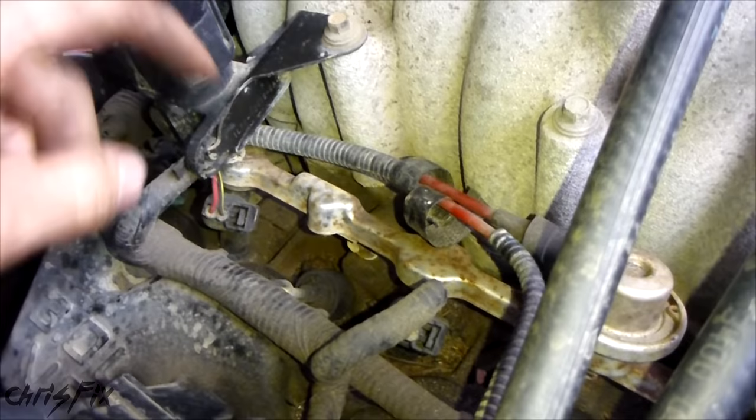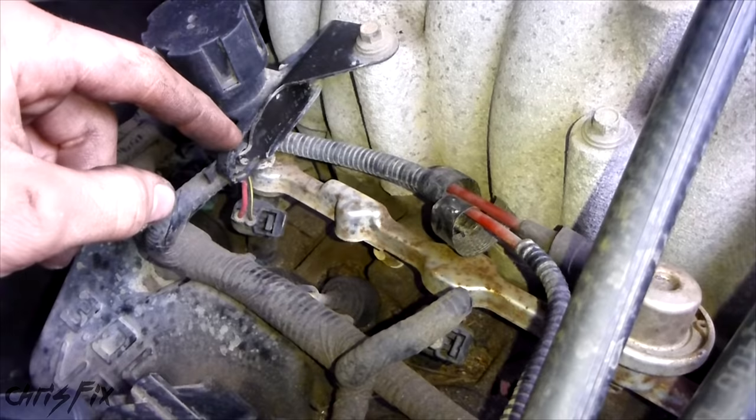This test will tell you which injector might not be firing or might be firing inconsistently, but that's all it's going to tell you. It won't let you know if there's a bad spray pattern because the injector is clogged, or if the pin isn't going all the way down because the spring is worn out, or if the injector is clogged so gasoline is leaking in. So this is just one method you could use.